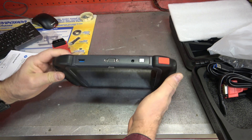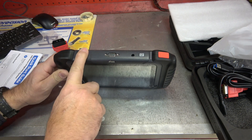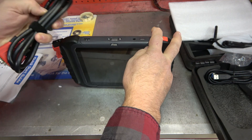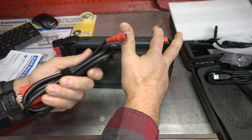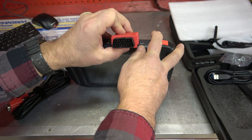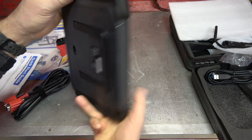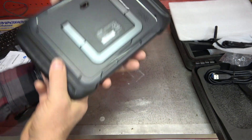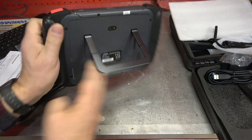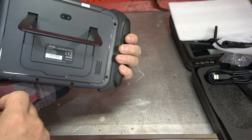We have a power on/off button and a power plug that's insertable. Now I understand what's going on — when you have an OBD1 system, you're often required to hook up an external power supply because the 16-pin OBD2 connector already has power. That secondary cord handles that. I was not aware this had OBD1 functions, but I'm very impressed. Nice rubberized grip on the sides, a camera on the back, and I love that it has a kickstand for propping on a table or hanging off a steering wheel while working on a car.